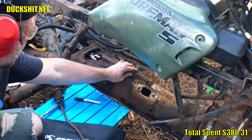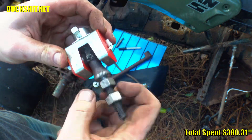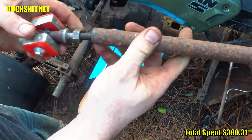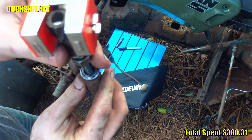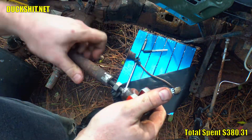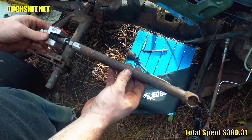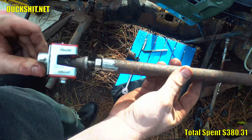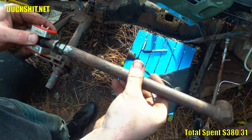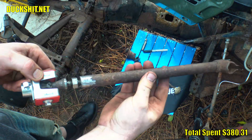I measured out the remainder of the shaft to figure out approximately how long I wanted it to be, then cut it down. This little short guy ought to fit properly. I got a brand new shift coupler — yes it's a red one. These actually work quite well; there's one in Ruby that's been there for eight years without a failure. It might be the only urethane part I use on my Volkswagen. I always carry a spare just in case. What you didn't see off camera was I welded a bolt into the shifter end. Here's what I came up with: my shifter shaft is about a foot long, with my shift coupler on the end going into the stock end. The new nut in here spins and allows me to lengthen or shorten the rod, and I can tighten it down at any angle.